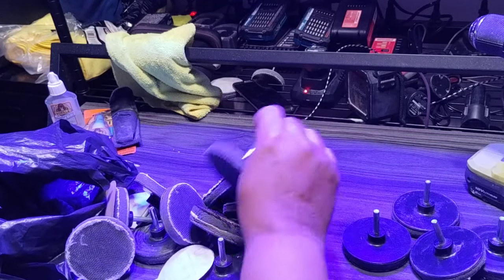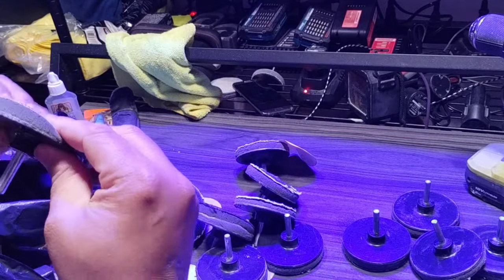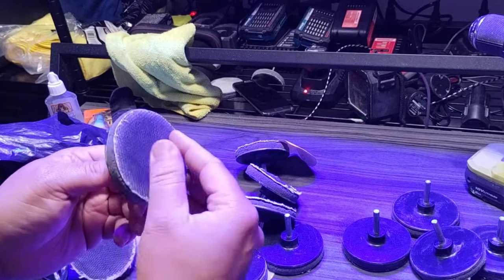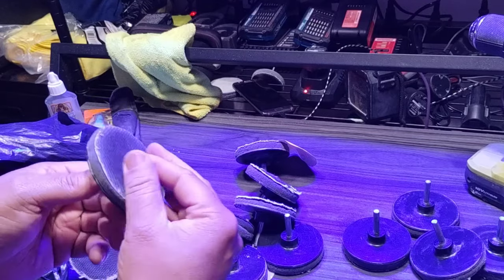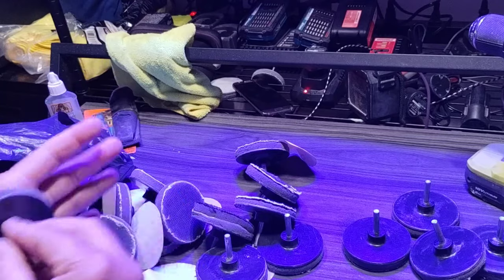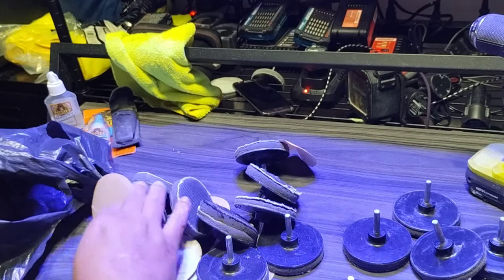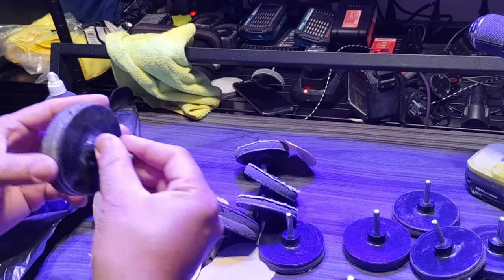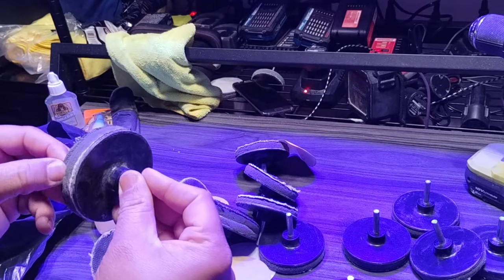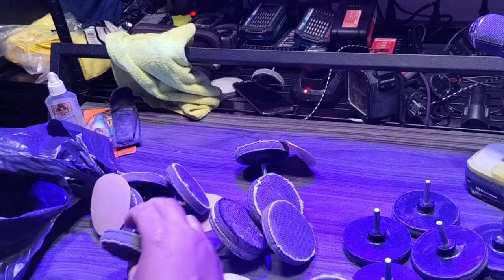With an interface pad glued to it. That's what these are, okay? They're considered to be throwaways because when they glue them down like this, they just go bad. The Velcro goes bad, or the padding itself gets too smushy or too broken in, and it just gets too soft to really use correctly. So your discs start sticking and everything is floppy, so they go bad. Then you have to replace them, but everything else is good.